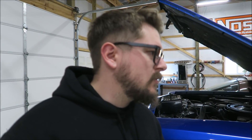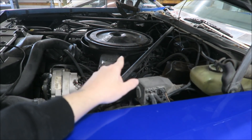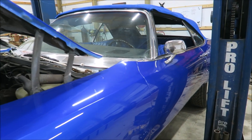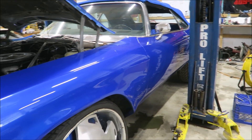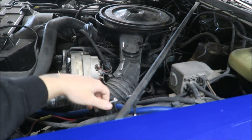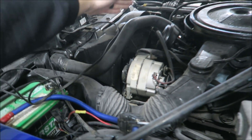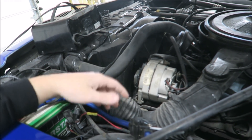Unlike the last one, this guy said there's no real time limit on it, which is nice — no rushing to find parts or getting the wrong parts. I'll rip the engine and transmission out. It'll probably need a new driveshaft. I can use the stock fuel line as the return and run another feed line. I'll probably use a Walbro 255 inline pump. For motor mounts, I'll keep it simple and use the ICT Billet adapter plates.